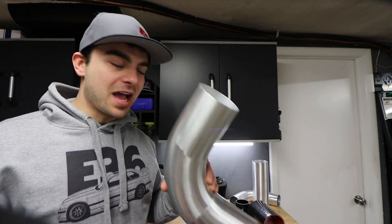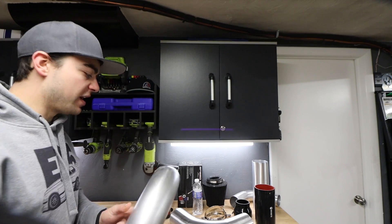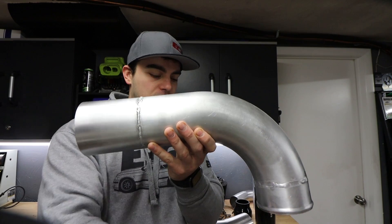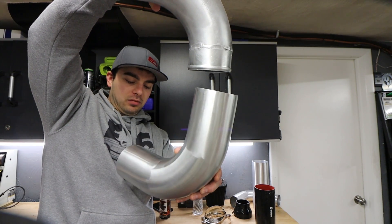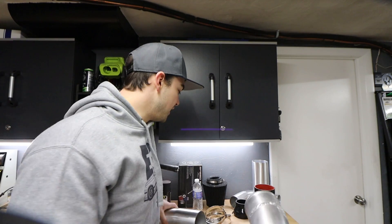All the rest of the parts and pieces came in today to get the intake finished up. I got another 90-degree, got my four-inch silicone coupler and the clamps to go along with it, and of course I have the piece that I made. I'm going to go throttle body, go down, then silicone coupler, and this is probably going to shoot over and sit in the bumper area with the filter on the end. I'll have to trim this down some, but I think the first thing I need to do is take the bumper off.